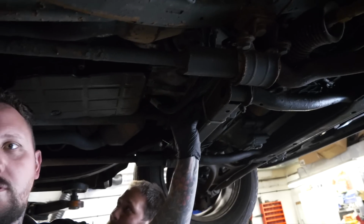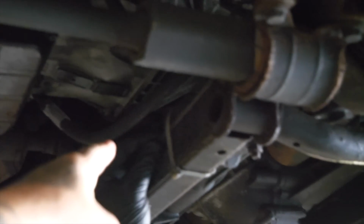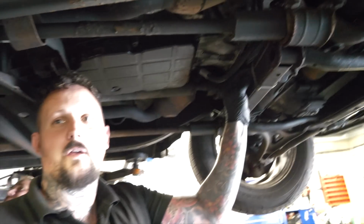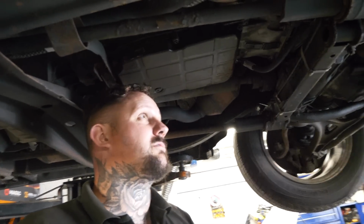They come in a pair, so you have to buy both. Two cats then, nice. So what have we found? A brake pipe. Yes, cable tied to the subframe. And it rattles around, which is not really what you want on your brakes. You don't want it chafing a hole in it, really, no.